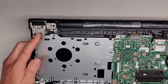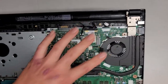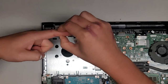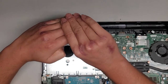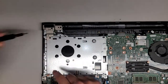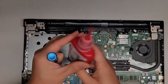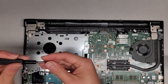As I mentioned, the hinges — you can see there are only two screws holding here and one screw holding here. If you open and close this and you're not careful, this can actually break at these plastic points, because the screws are only holding on this thin spot. When it twists, it can rip it out. Normally, you want all the screws in so that when you open and close it, it's holding everything firmly. I've seen a lot of models where these screws come a little loose, and because of that it ends up breaking itself.